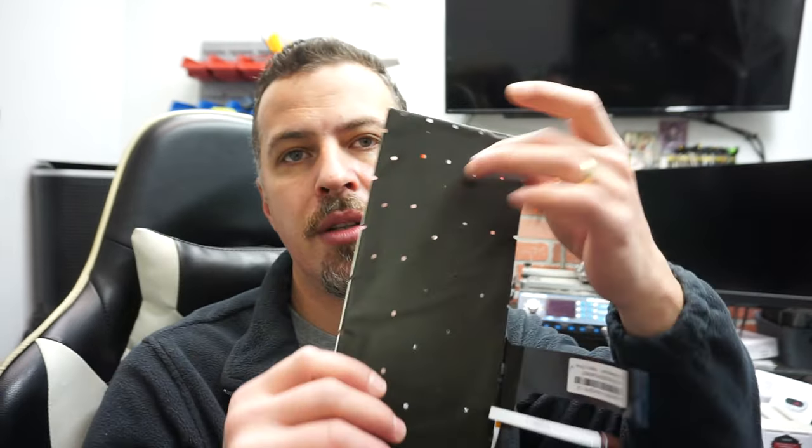Just have patience. Make sure you see where particular screws are coming from, because there are going to be quite a couple of screws. Judging from other MSI computers which I've opened so far, the keyboard has these little holes, which means there are going to be some plastic rivets. You'll have to be careful when you remove that rivet, so you can melt it back on, or you can use a good heat gun to attach the keyboard to the top frame.